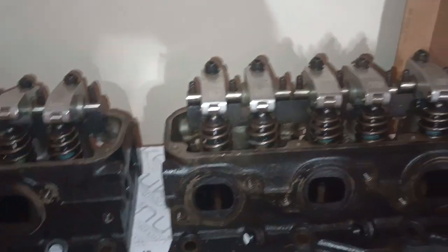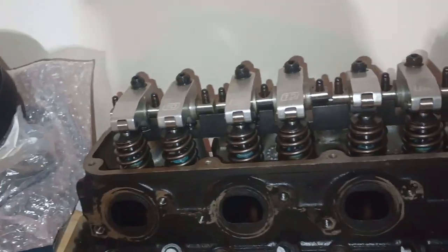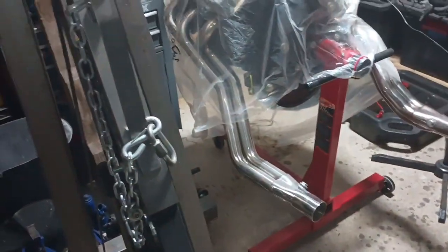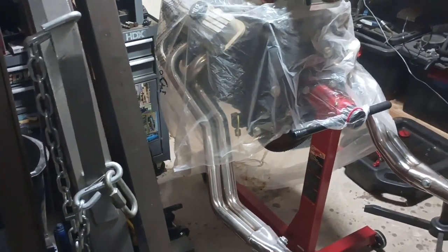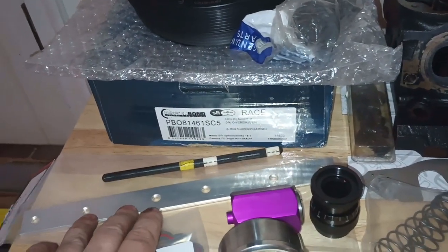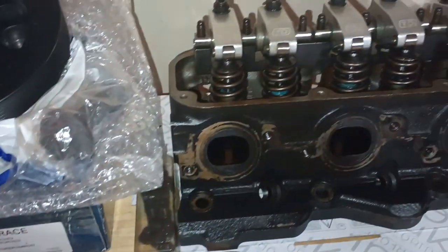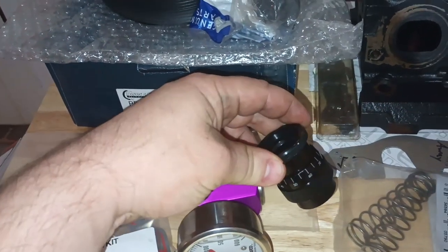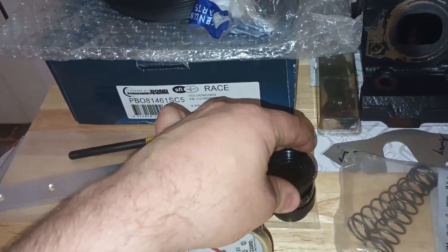Those will be getting a few more parts ready to go, and then we will start getting it ready to assemble on the engine. I need to pick up some more head studs just like we have on Bad Grandpa, and I also need some MLS gaskets to go underneath them. Then we will start going into valve train geometry — we'll probably see what kind of shimming we may need under the pedestals and what kind of install height we're dealing with on the springs, and make any adjustments there.